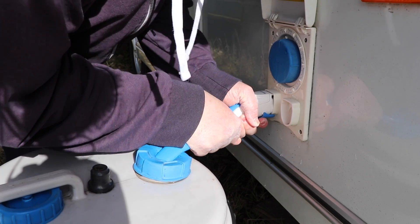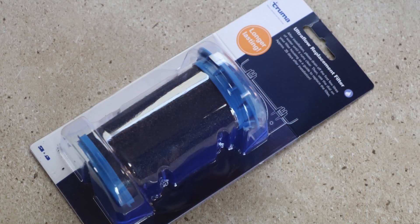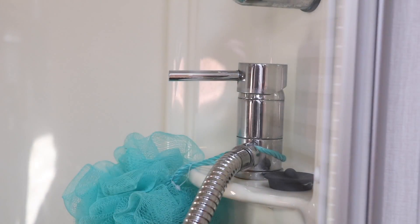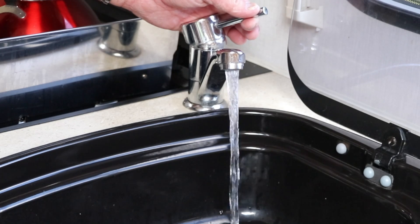Connect the Aquaroll as if you were filling up the caravan water from dry. Here's a crucial step: if you have a charcoal-based filter — we have a Truma Ultraflow with a charcoal water filter — remove any filters from the system, because the PuraClean will cause them to break down. With the water hooked up and the filter removed, make sure the drain-down tap is closed, taps and shower are closed, then prime all the taps as per normal so you have water throughout the system. If you've got a hot water tank, make sure that's full too, but don't switch on the hot water — leave it cold.